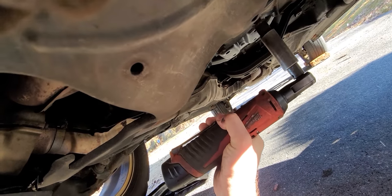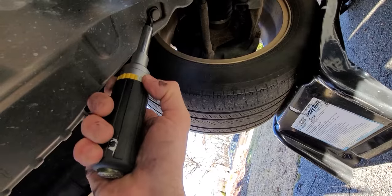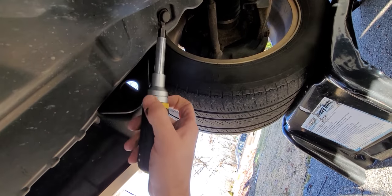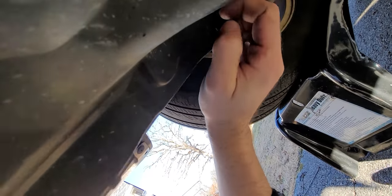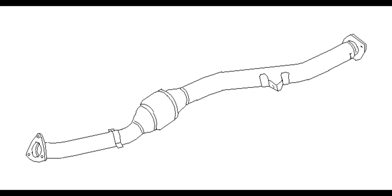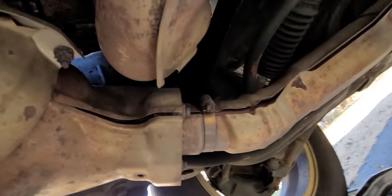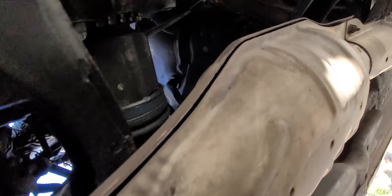It's four 12mm bolts and four plastic clips. You just pull up on them and you remove them. Just for a better idea, this is the part of the exhaust I'm replacing — it's the downstream catalytic converter. We find that it is attached in three places: one of them is right here, and you've got three pains in the ass down the front by the manifold.